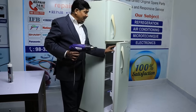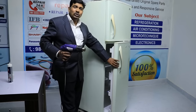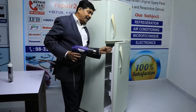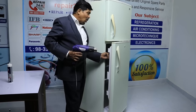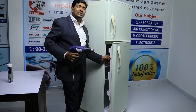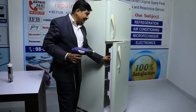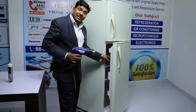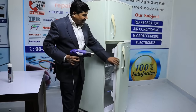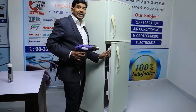The other solution is for when the gaps inside the door rubber seal become very hard and stiff, which disturbs its adjustment. When outside air starts entering and the cold air inside starts leaking out, the fridge's cooling is maintained very late, the compressor has to run for a long time, electric bills increase, and the cooling inside also reduces because of the continuous cooling leak.